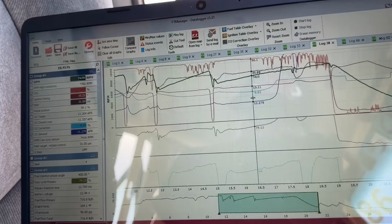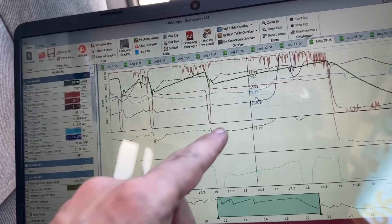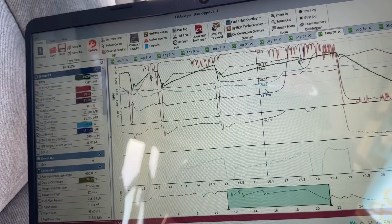I also wanted to mention, when you guys saw me flow test some injectors back at the house and they weren't all matching the same flow rates, they were old injectors. I did actually swap those out for some fresh injectors. Definitely forgot to mention that, but we have new injectors for this trip. And with those fuel changes, we actually had more fuel compared to the old setup because it's pulling 10% without any changes to the tune.